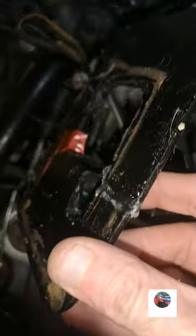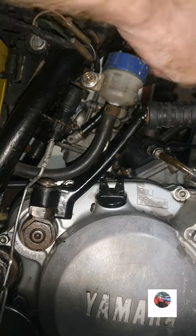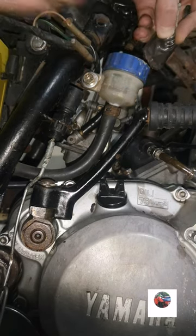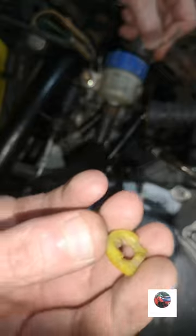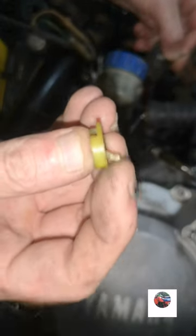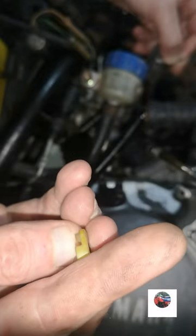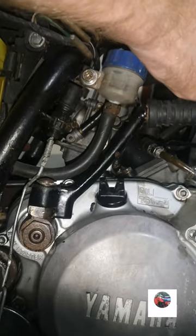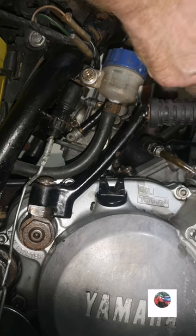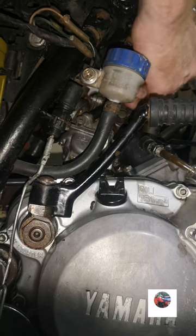I think I showed this as well the other day. I've glued that up with shoe goo, if you can see, but push that over the top of the carb so it's nipped up like that. And put that on that way, so the pointer's facing that way because that pointer drops into the slide to keep the cable in. I think it's a bit bent, that it should be over that way a bit, but it'll just still work. It's come out that way, so it should still go in. Just tilt the carb so I'm seeing it.